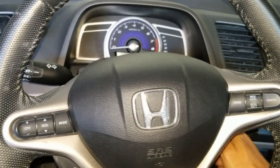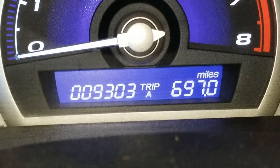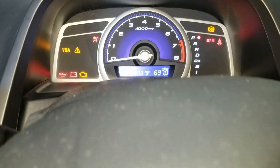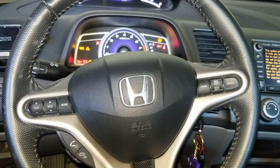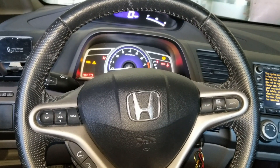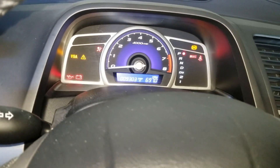Let me turn on the car real quick to ACC or ON. I've been driving for 697 miles already and it's still not ready. So today we're going to do a test — I need to start the car, warm it up, and then hit the gas and ride it up to 3000 RPM for about three minutes. Hopefully that will check the catalytic converter monitor.